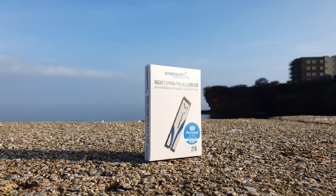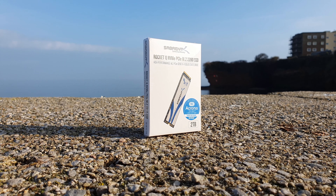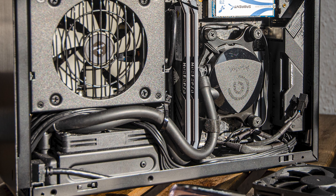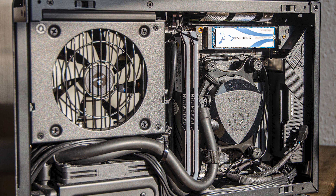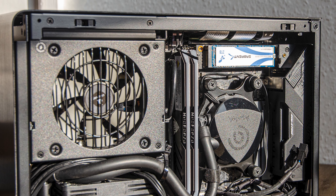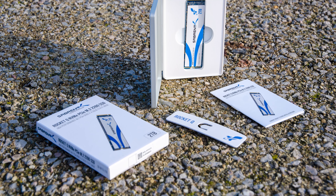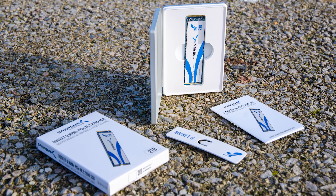Of course this is a worst-case scenario employed on purpose, because in my SFX build there is no active cooling whatsoever on the motherboard side, plus there is always extra heat coming from the motherboard's chipset. So in any minimally ventilated case you shouldn't encounter any problems like this, and don't forget that Sabrent even sells their excellent heatsink upgrade kit that will fit any single and double-sided M.2. As for the second scenario with the fan on, the extra airflow makes a huge impact — we shave off exactly 33 degrees Celsius from the peak recorded temperature and thus no more thermal throttling occurs.